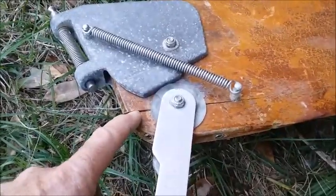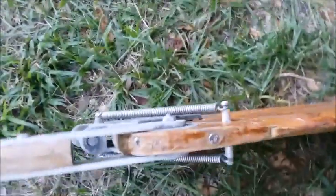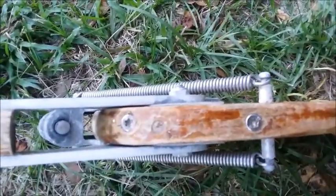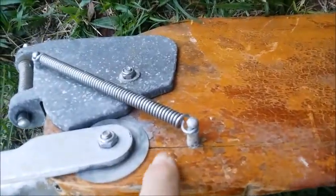Here's one that had that split that we spoke of. What we did was we drilled through the backside of this rudder and screwed in some three-inch stainless steel screws that go all the way through both sides of the split.